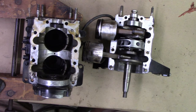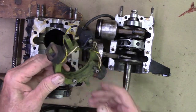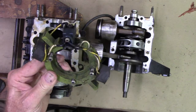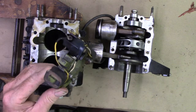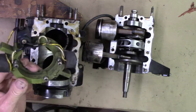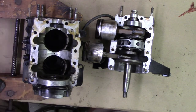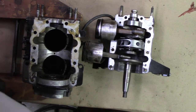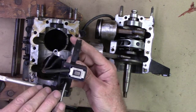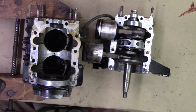The coils are in good shape. Everything else looked okay — the stators checked out okay, no broken wires, no evidence of the flywheel hitting the stators. The pickup coil is on the other unit and is okay. I was able to start the engine and it ran fine. I actually took it out on a lake and ran it for a little bit and it seemed to be okay.